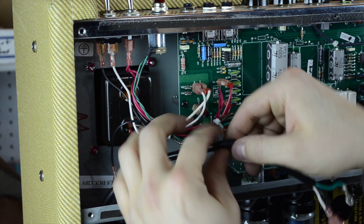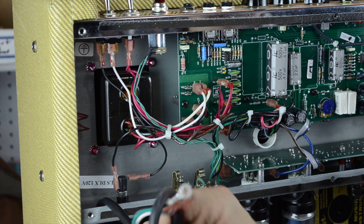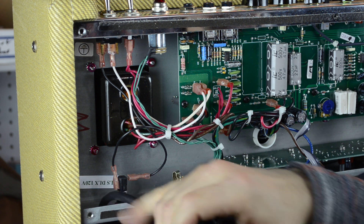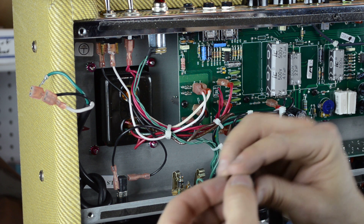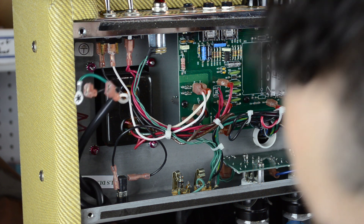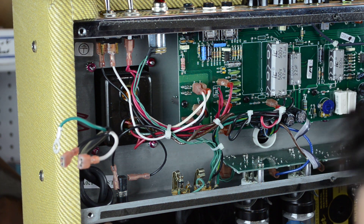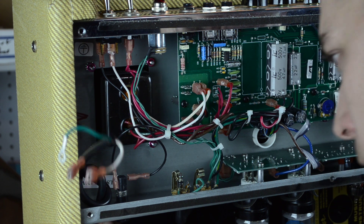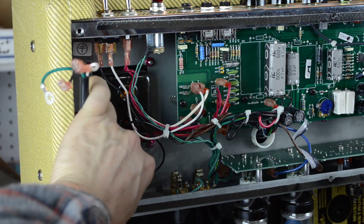There's where it was restrained before. If we put a knot in it we've got to make sure the knot's down here so we have enough wire left over. I'm just going to gently knot this — there's the strain relief spot. Even if the strain relief doesn't work we still have plenty of wire up in there. To mount the strain relief again you just open it up, put the cord inside, shut it, and squeeze it into the hole. It's easier said than done because you do have to compress the cord quite a bit.